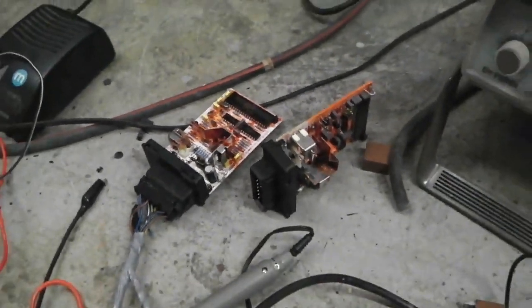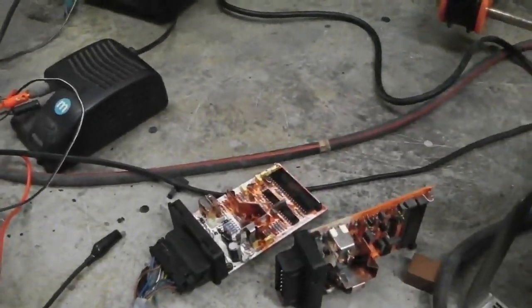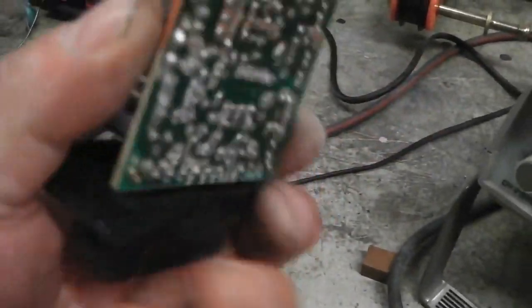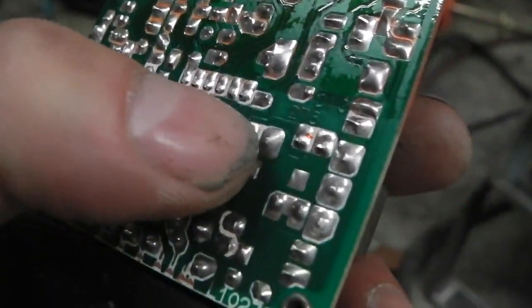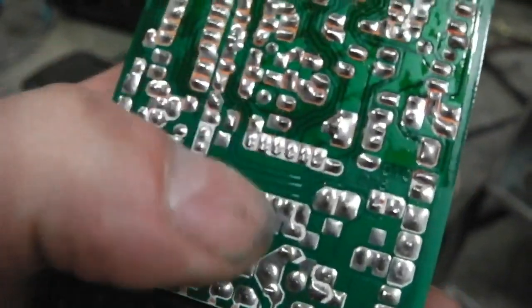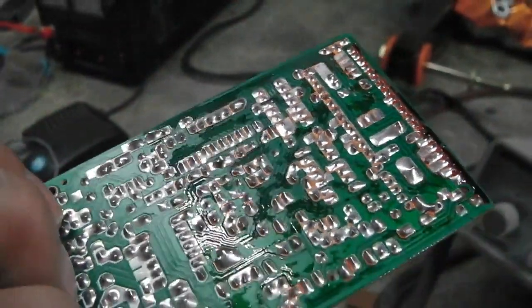Boards could end up getting chucked. I wouldn't do that, I'd have kept them, but they'd be marked up faulty. However, both units now perform totally differently with the coating removed. For any solder joint that you can see, you've got to get a microscope out and you'll see little fractures. Get your soldering iron, once the board's clean with the thinners, touch them back in and let that reflow. This one actually just started working without any resoldering work, just by taking the protective layer off the back. That began to work totally differently.